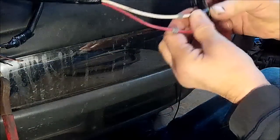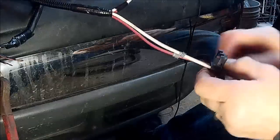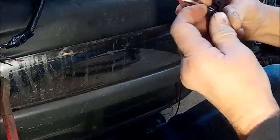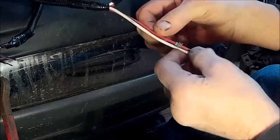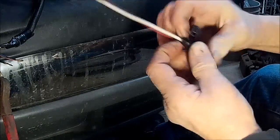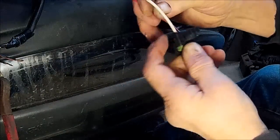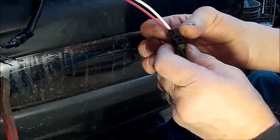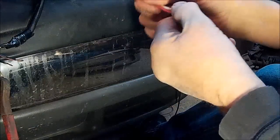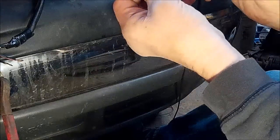Just go in and they lock like that. This particular one, since I'm building brand new ones, it doesn't much matter where I happen to put these. These get pushed down inside of that cavity there. Straight down in, and then this is the last part that goes down that locks it in, and you have a nice waterproof connector. And the next piece that goes on will be this one here.